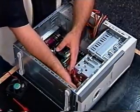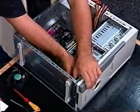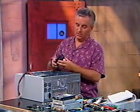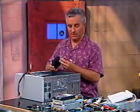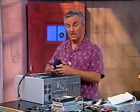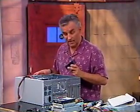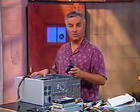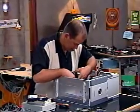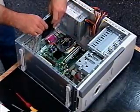You may actually have to bolt the fan down on the inside of your system using more screws. The wire feeds right up through a slot in the muffin fan cage, and this connector is going to connect to a power tail that comes off the power supply. Sometimes fans also connect directly to the motherboard, which is nice because their rotational speed can be monitored so you know the fan is working. The worst thing that can happen is the fans die, the cooling dies, and the case overheats. The back fan is going to draw air out the back.